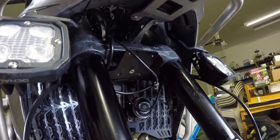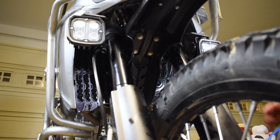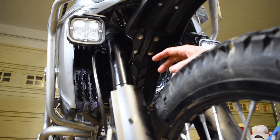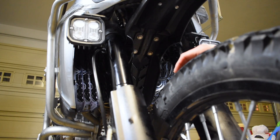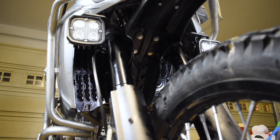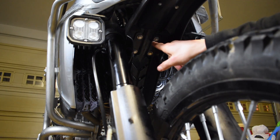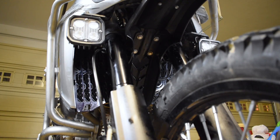Now I'm ready to put the fender on. It just bolts up underneath with the adapter that comes with it. My kit actually came with the adapter already taped to it — it comes with an additional adapter but that one's not used. With this kit it comes with the hardware — just put those four bolts in the bottom and make sure and Loctite it.